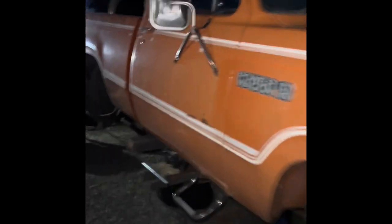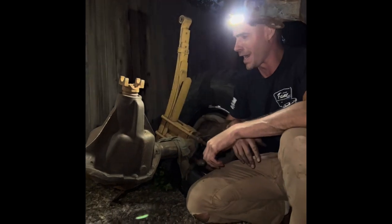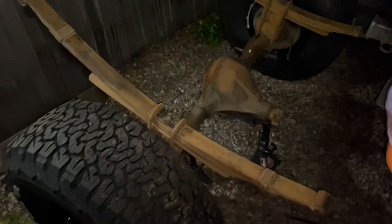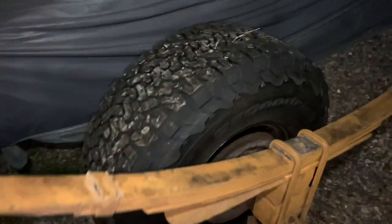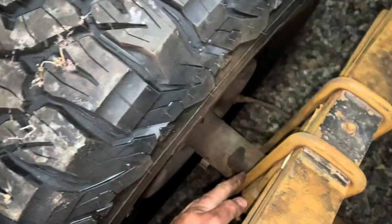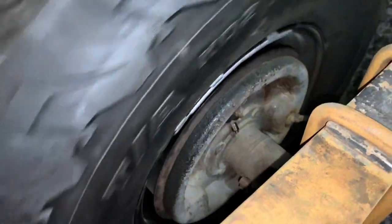There's no time for judgment — we've got to get this truck put together. A little bit of wire brush, a little hand sanding, and it's not too bad. Got the old girl up on jack stands; I'll pop these wheels off to keep overspray off them. Then we can disassemble the drum assemblies, get new shoes, wheel cylinders, all the goodies. The drum backing plates sound pretty crunchy — we're going to want to replace that.